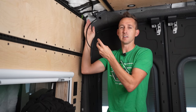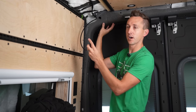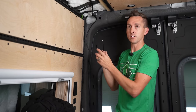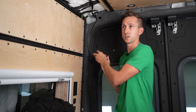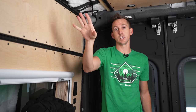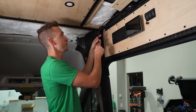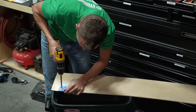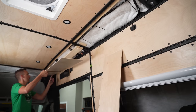There was about 10 feet of extra wire, so it's coiled up throughout the length of this cross member. We're going to leave this hanging for now and it'll be coming up through the roof later. We'll put the ceiling panels back on and start working up towards the actual booster. Before we put the ceiling panels up, we need to drill a hole in the ceiling panel where this wire comes out and goes into the booster mounted right here.